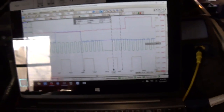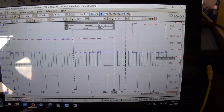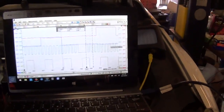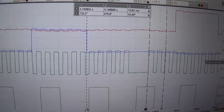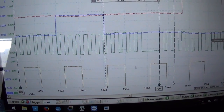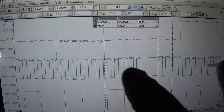Okay, now by our calculation, if it was just 3 teeth off, it would have been 46. But stretch chain. Exactly right. I was going to ask the viewers, Jim, that's supposed to be a critical thinking question. Why are we an extra 9 degrees advanced now? Yes, exactly right, because our chain is new and it's tighter, so obviously we're even a little more advanced. So that is beautiful. I like that. And so that's confirmed.